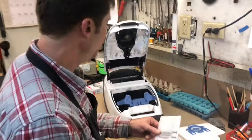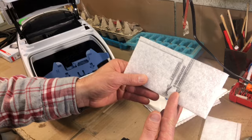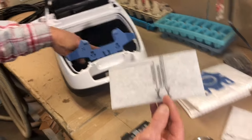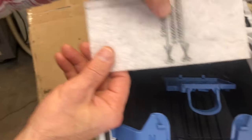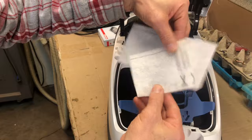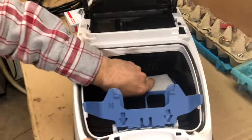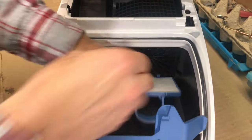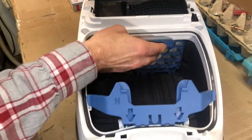Here are the bag and filters we'll put into our Miele. We're going to cut this filter so it fits inside the Miele canister. For this canister, we're going to cut the longer filter, which is this part right here. We'll put this in here — there are a couple of tabs that it sticks behind, which hold it in place, then shut the door. There's one filter installed.